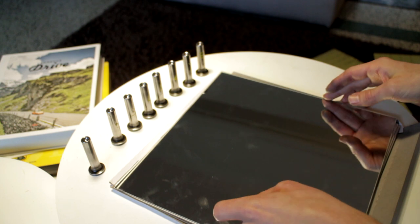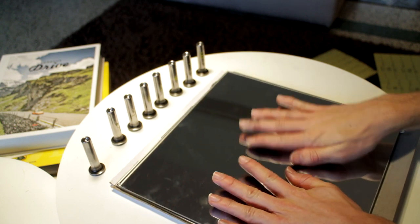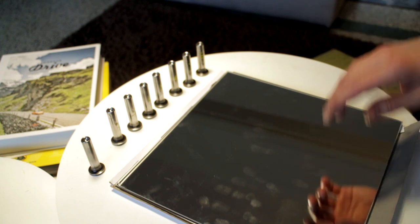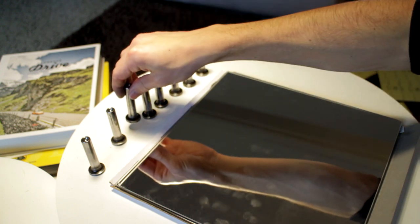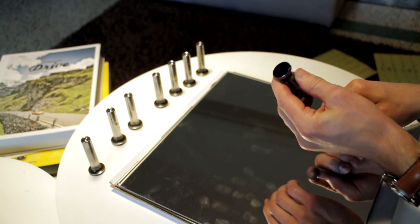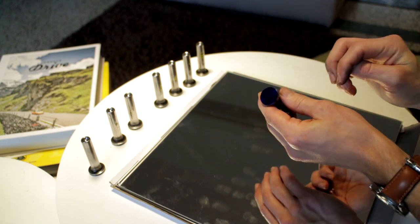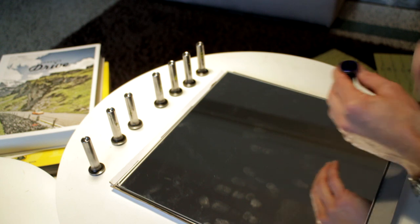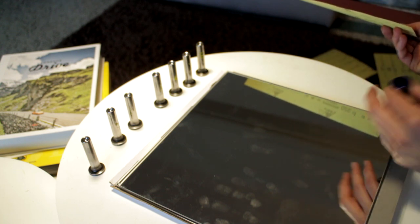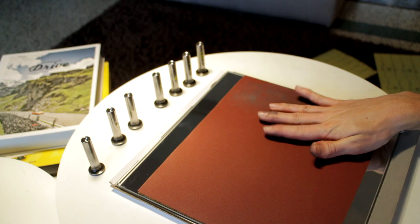What I have here is a mirror — a glass sheet — and I've stacked a couple together because it's a little bit sturdier. The way that we're going to reface these is actually quite easy. I've already done three. I've used a permanent marker to dye the tops — you can use machinist dye but I don't have it. That way we can see where we're removing material. I started with 600 grit but it took really long, so this is a 320 grit sheet of sandpaper and the mirrors are a completely flat surface.